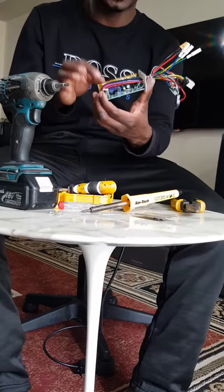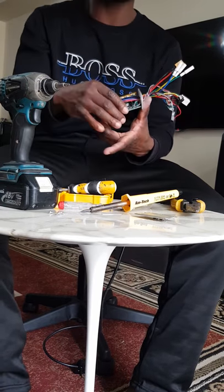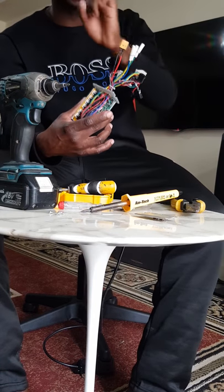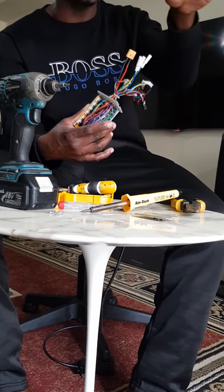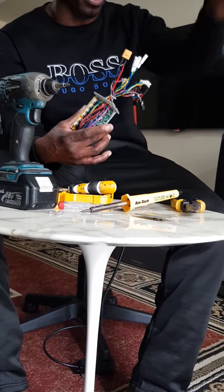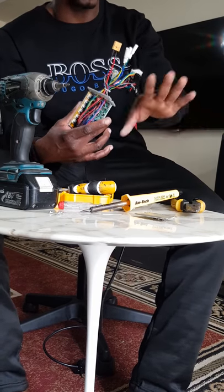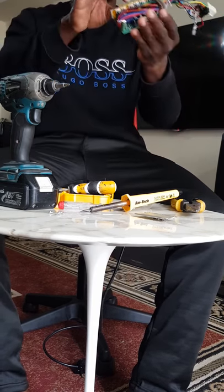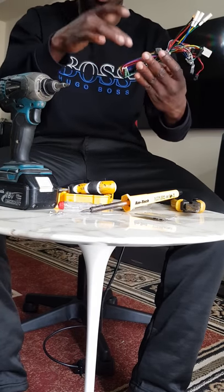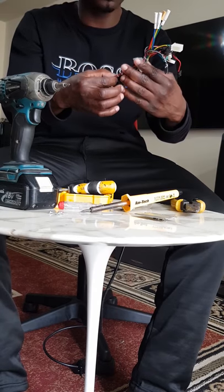But the problem is, how much is that new one cost? For instance, if it's the motor that is not working, everything else is working, and you're not seeing, usually when some of these scooters break down, they show those signs like an exclamation sign. That means it's got nothing to do with the motor. It might have something to do with your brake line or braking. Or sometimes the controller might be faulty and sending that. So that means you don't have to trace this MOSFET. You just have to trace other components on that and find out why they're not giving you instructions.